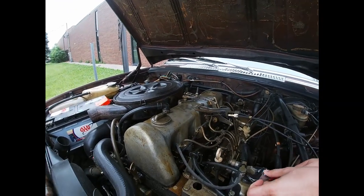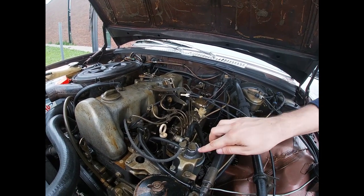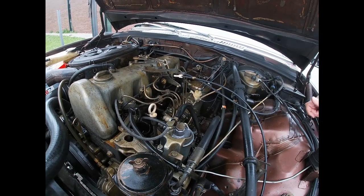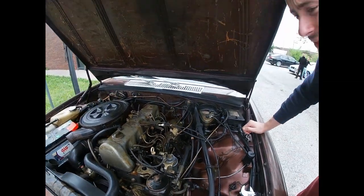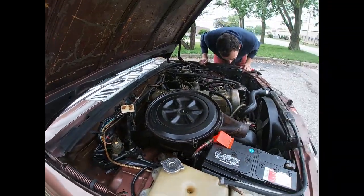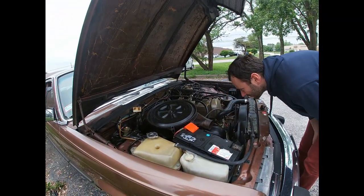So did you go to that shop in Gurnee? Did you work on it there? Not yet. Then just observe it. It shouldn't leak, because I already tried. Sometimes they're picky, the copper one, the aluminum one, and it's not the OEM. This banjo bolt right here is really picky. Sometimes you have to crank it a little bit more of a turn. I've had that before. It feels way worse with the copper washer. I'll look for that hose for you, so you can put it on.